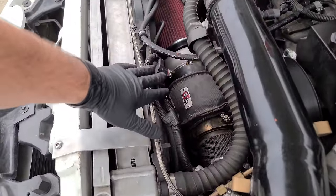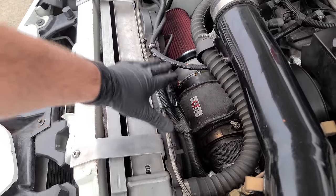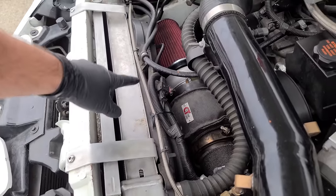So what I ended up doing was going to the junkyard after measuring the radiator, and I found factory fans from a Saab 9-3 for $50 with the factory shroud. That fixed all of my problems, guys. Factory fans, especially puller fans with a shroud, are usually the best option. If you can keep them on your car even after you modify it, definitely try and do so. Pusher fans aren't as good, and little aftermarket fans that aren't fully shrouded are not that good either.